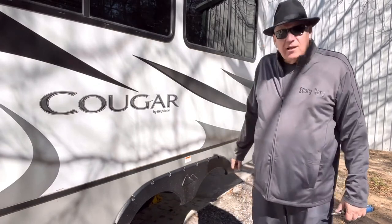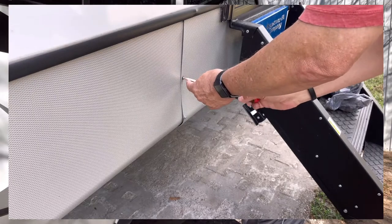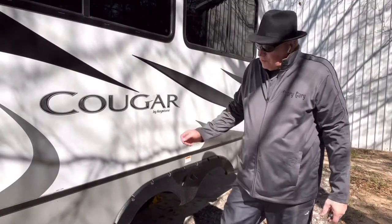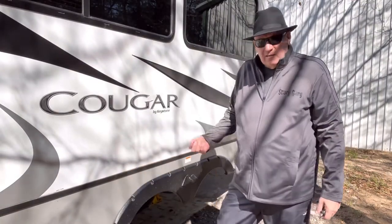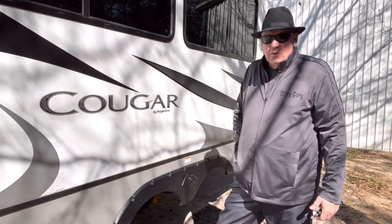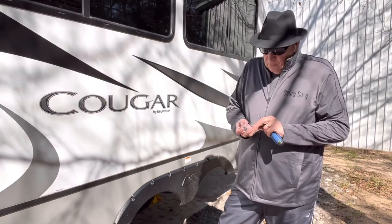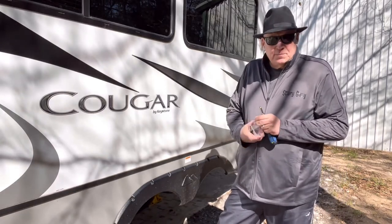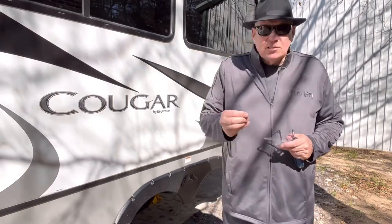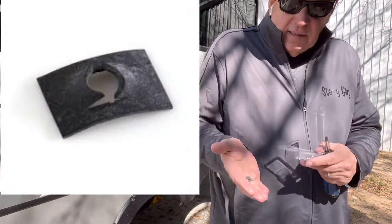Now, specifically on the outside, you're going to find a screw from time to time that basically just spins. Unfortunately, this is very thin aluminum, and the holes will become shredded out over time. So the best thing to do at that point is to have yourself what are called speed nuts. A speed nut is just a little piece of a nut that's flat.